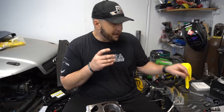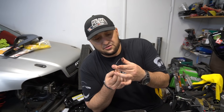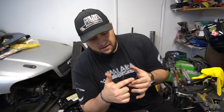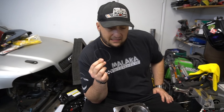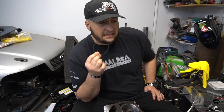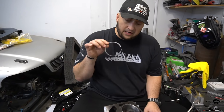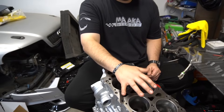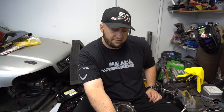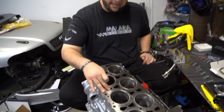Looking at the specs, we did go about a thou or two above them. Jay from Real Street recommends always going a little on the larger end - you don't want that ring to butt on the inside of the cylinder, because when it does and has nowhere to go, it warps and you lose compression or blow a cylinder out. We want to be careful because we are running nitrous in this car and going very aggressive with cylinder pressure. We're using a stainless steel o-ring and a copper head gasket - still waiting on that but it's in the works - plus half-inch head studs.